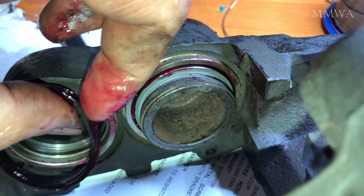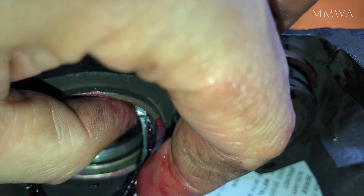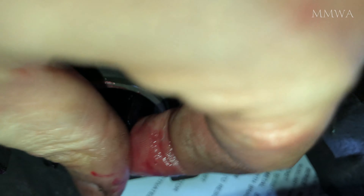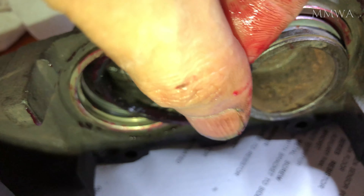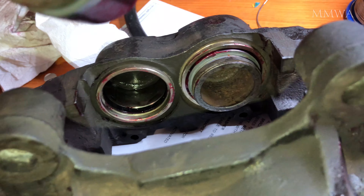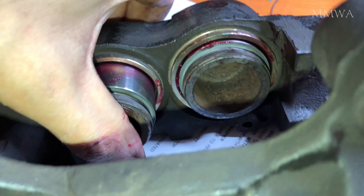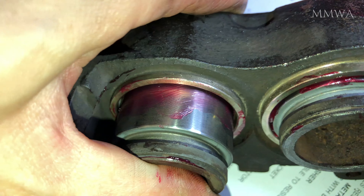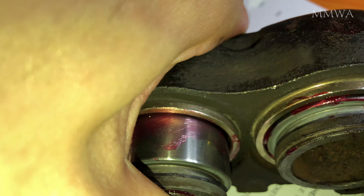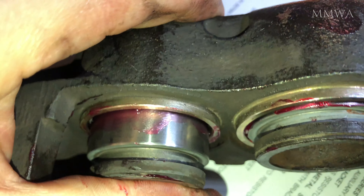This is impossible to do one-handed. I'll probably make another video using my actual proper camera and a tripod to show how I did this when I do the other side — this is just to practice from. So all of these parts get lubricated with brake caliper rubber grease. The pistons do squeeze in easily as long as they're going in straight.